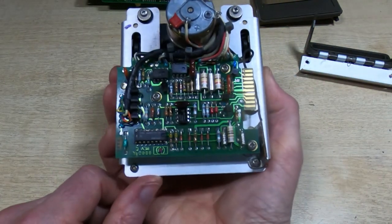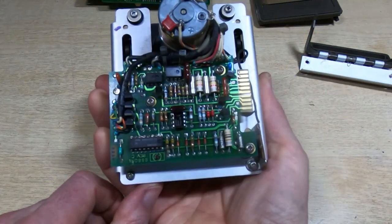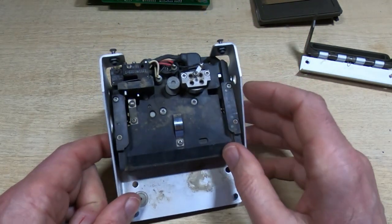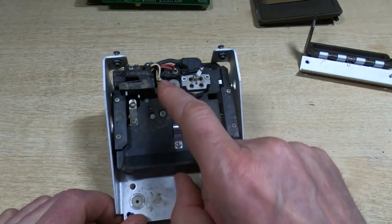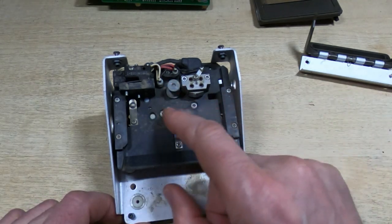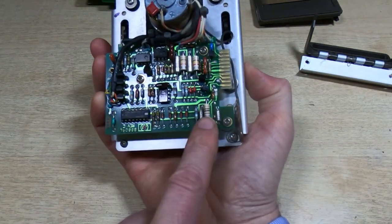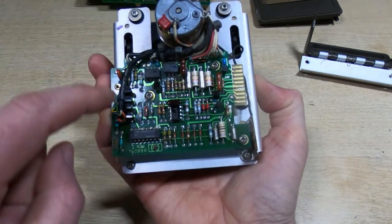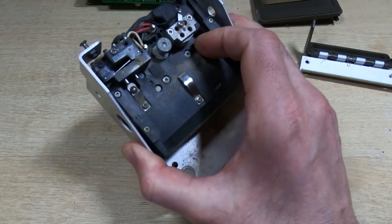The control board interface board is on the rear of these drives — a very nice self-contained unit, fairly easy to get apart. What we need to do is remove the capstan so we can replace that part. To get these apart, all we have to do is take out the three screws that hold the PCB to the back, then remove the four screws that go through the rubber grommets holding the main drive assembly to the bracket, and then we can separate the two parts.